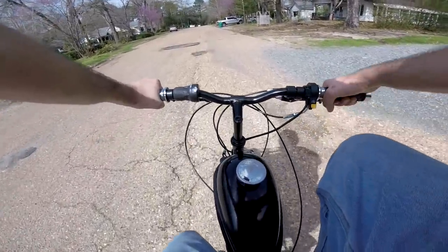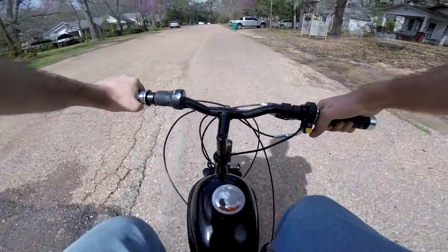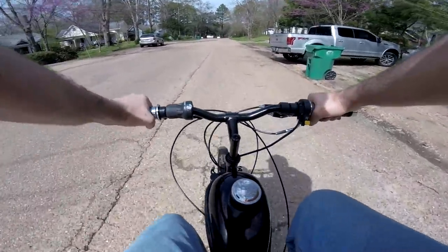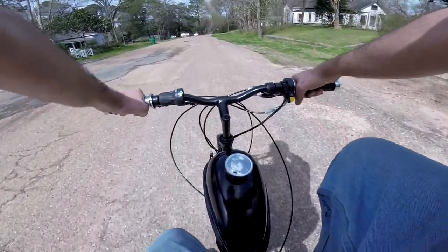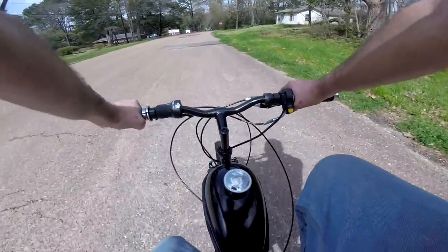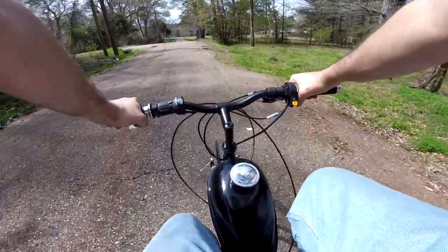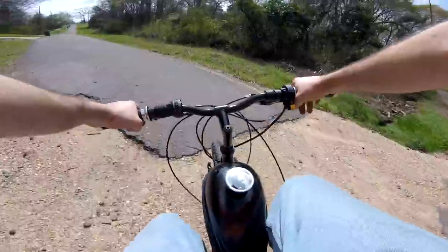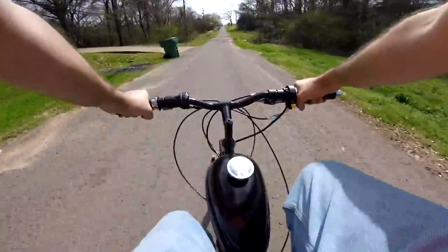The bike immediately stripped out the keyway, and just collapsed a small section of the hub where the set screw was. So we needed to come up with something that was going to work. I decided to go back to a fail-safe quick steel epoxy putty. I was pretty sure this wasn't going to work, but that stuff had done some amazing things for me in the past. So I decided what I would do is take the Dremel and put a bunch of slots in the clamp and on the hub so that I could give the quick steel something to bite onto.